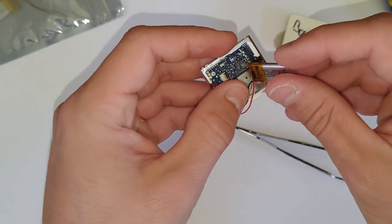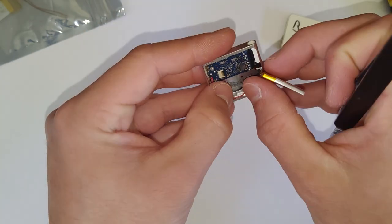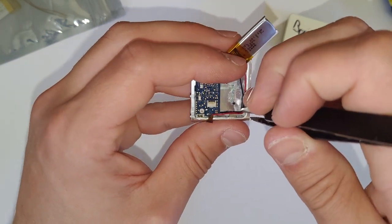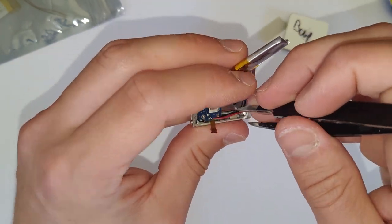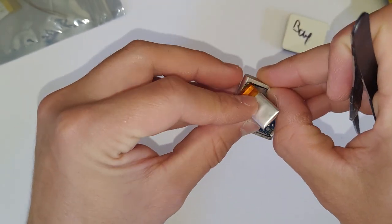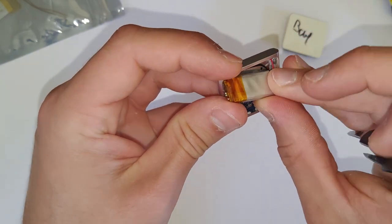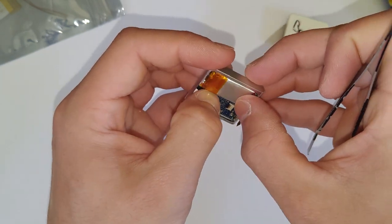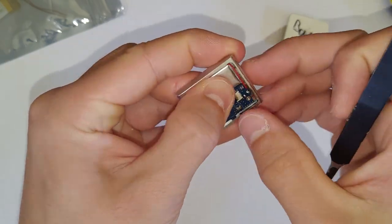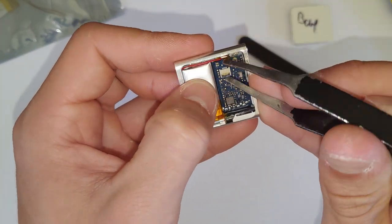Now tucking that battery back in as well. This is probably the most important part of this whole process — when you're putting that battery back in, you want to make sure you tuck those wires out of the way like how it was when you opened it. Because if you don't, the battery will sit up a lot more than it's supposed to and you probably won't be able to close the thing properly. Grab your tweezers and just tuck those wires in underneath there, really get them up into the corners. And obviously don't forget to plug those buttons back in either.